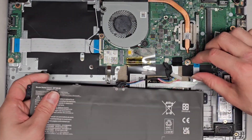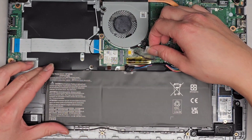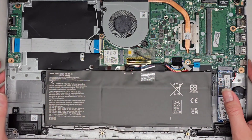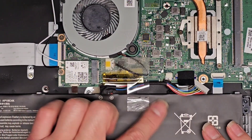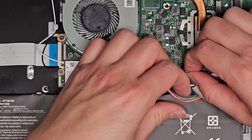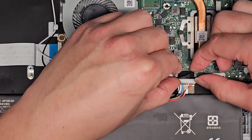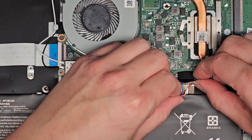Let's go ahead and put the battery in place — just drop it in. There are no screws holding it down, just the tape adhesive on top, which isn't really holding it down either. Make sure to be careful you don't flip this upside down while the battery is in there or the battery will flip and fall out. Get this connector lined up — make sure you have the right wires in the right direction and then pinch it together.